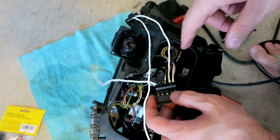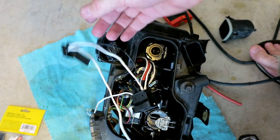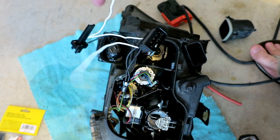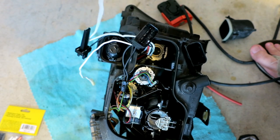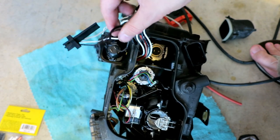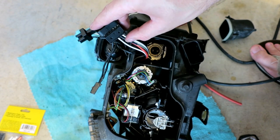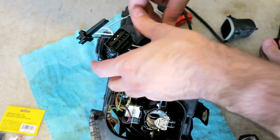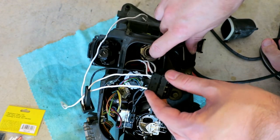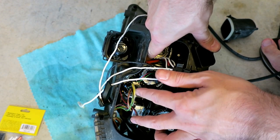So that's that. Now I'm going to snap this connector back down. So all the cracked wiring is being repaired. The worst parts were the parts leading to the angel eyes. These two wires here, this is ground and this is positive. The connector leading to the ballast was in rough shape, and the ends of these wires going into this connector were in kind of rough shape. Wherever cracking stopped, there's heat shrink going over that point. And then over here, these wires are soft and fine.